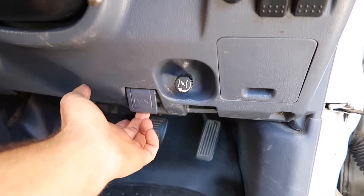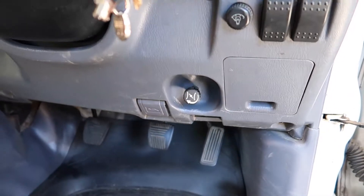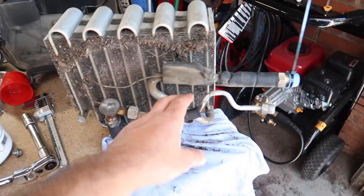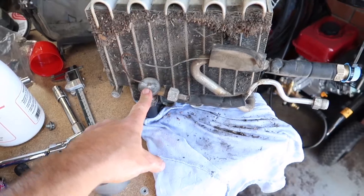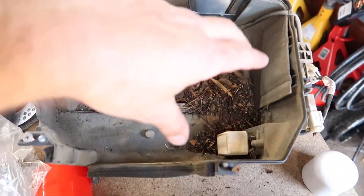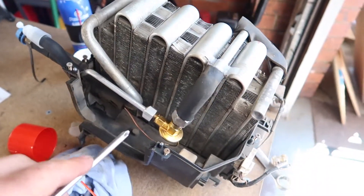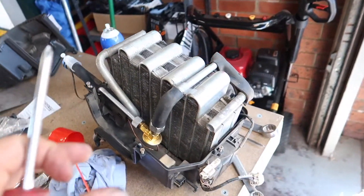Don't forget to put on your bonnet cable and throttle control cable. Now this side is done and I can go ahead and work on the evaporator. I'm going to change that pipe and also replace the TX valve, and give everything a good clean because it's filthy inside the housing. Got my new TX valve on there and new pipe on there, now putting it in the box and putting the other half on.